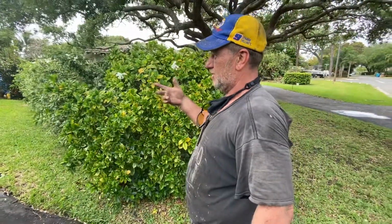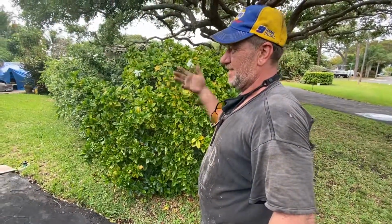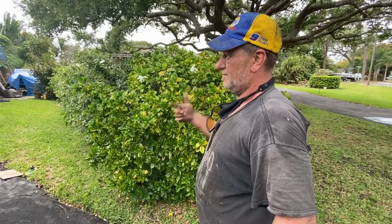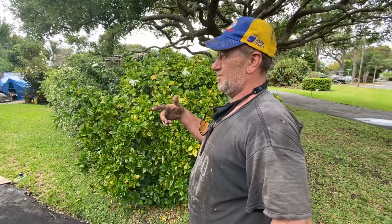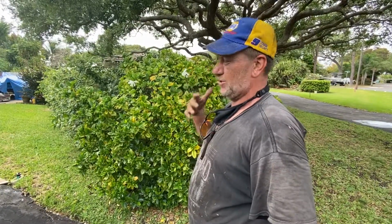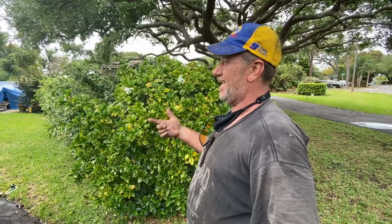Complete shoes on both sides, master cylinders, wheel cylinders on both sides. They were frozen up. Front brake pads, the calipers were just locked up. Master cylinder was just gooed. We tried to clean that. That didn't do no good. We ended up replacing that.